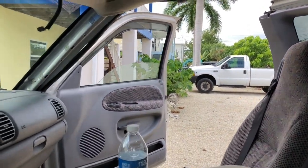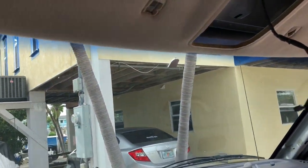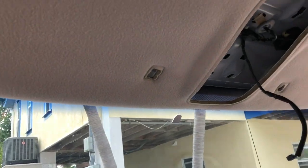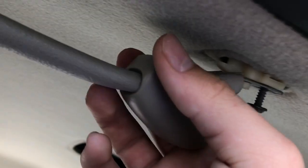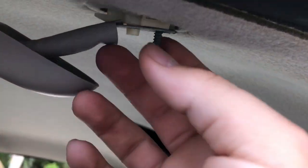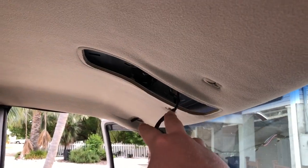I didn't record a lot of it because I was struggling. I had to take these screws off — I took the overhead console, I filmed that part. I don't think I filmed the auto-dimming; it's just one of these allen keys and you do trial and error. One thing I did this time, but not last time, was that I also took this off. This part broke — the only negative thing about these trucks is that the Dodge plastic is very poorly made. It's a split, so I could easily push it back. You pry this down, and then there's a screw that pulls down, then you slide it back. That allows me to pull this side down more, because this harness stretches across the entire headliner, unlike the other one where it just went to the overhead console.